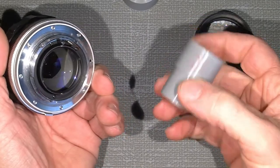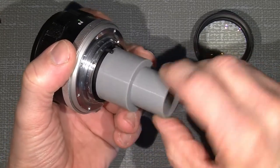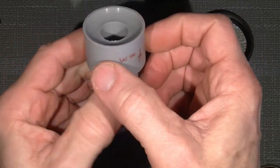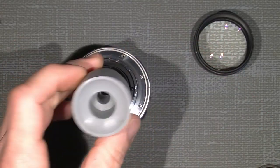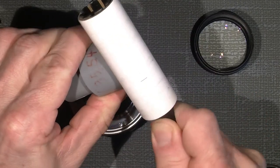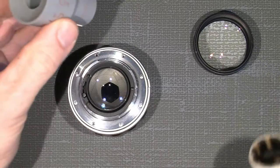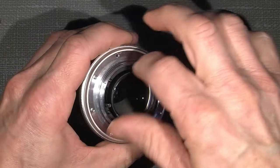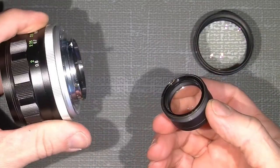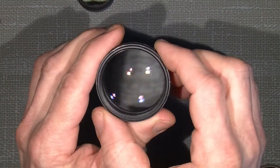Those are rubber tools, which are very handy when cleaning lenses, but also very useful for unscrewing some lens screws or retaining rings. But since I do not have a clean room, I need to clean my tools here, and with that I will use a lint cleaner, which is very handy for taking off very small hairs that sometimes can be on that kind of tool. Very annoying, but so it is. And when it's free, it just pops out. Put the body aside.